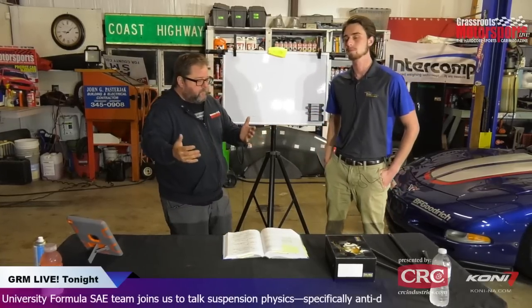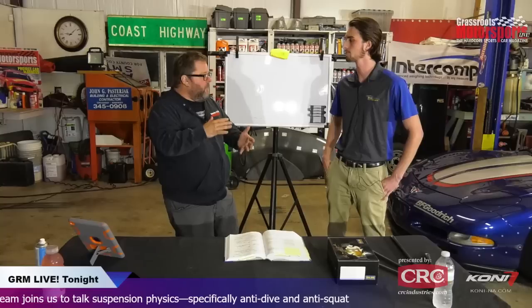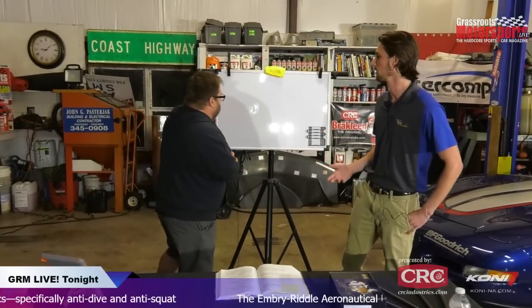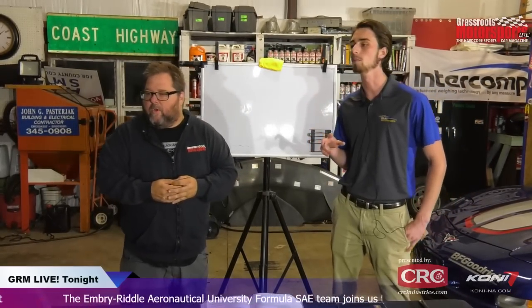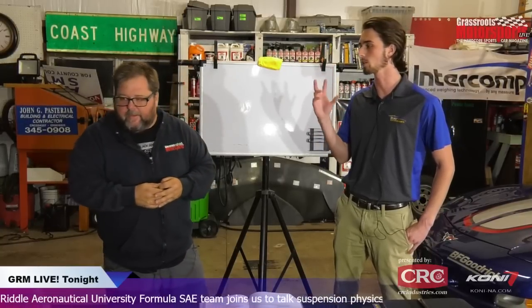Or if you think about an old gasser or dragster, something with ladder bars in the back. Exactly. When a load's applied to the back, the rear actually lifts up because you're creating leverage. So you can actually have more than anti-squat. It's called pro-lift geometry, where you go above 100%, and now some of that load is pushing up instead of pushing you forward, which increases your traction.